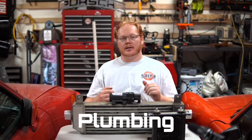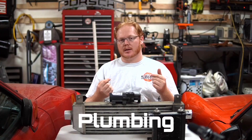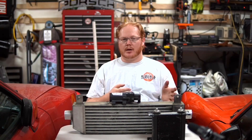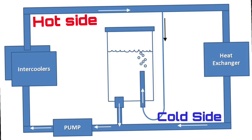Next we'll need some kind of reservoir system for holding the water. I recommend going with the same basic setup we did on the radiator for a self-purging system — take a look at this diagram. The hot water is on the high point of the system and a small line comes off of that and goes to the tank; this is the purge portion and allows air to come out of the system. A separate line from the bottom of the tank goes to a point on the cold side, making this a self-cycling, self-bleeding system.